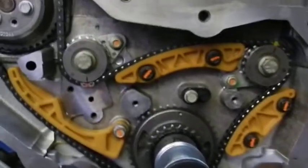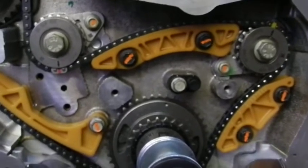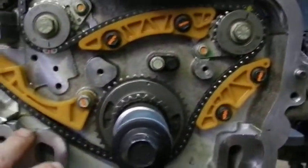What I've done is — because it can be days between when I come back to actually doing any work on this engine — I've decided that every bolt that I torque, I'm going to put a nice orange stripe on, just to let me know. When I come back I can look at the front of this and say yep, that's done.